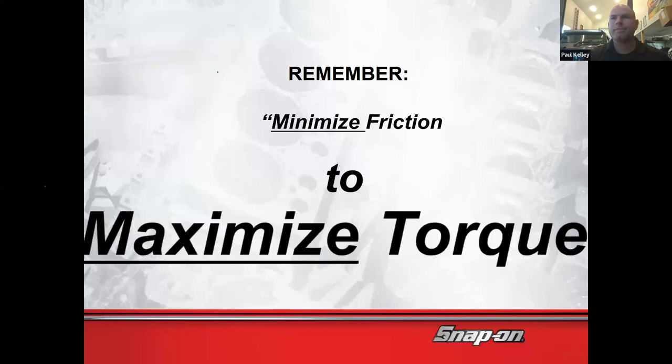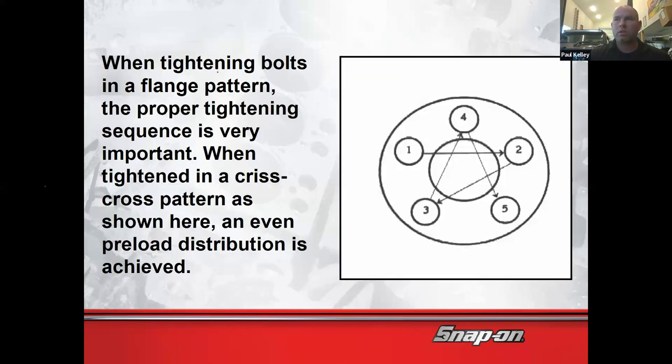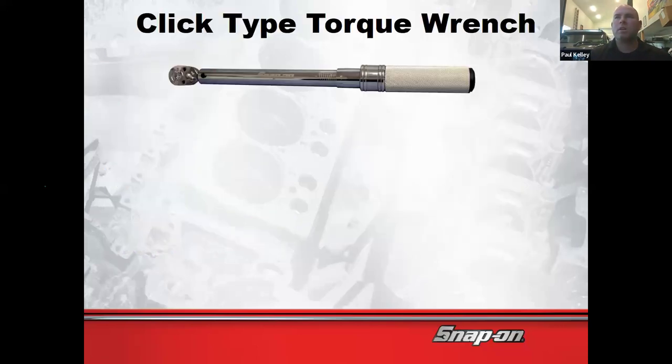Y'all understand. All right. So as we continue, it does talk a little bit about torque sequences. So you guys should be familiar. That's why we're torquing lug nuts in a star pattern, different types of torque wrenches. You need to hold these on the grip, by the way. If you're choking up on it like you're playing baseball, it's not going to read correctly. You need to be somewhere down here,